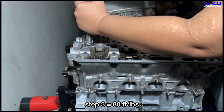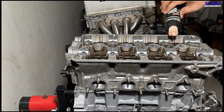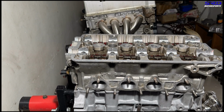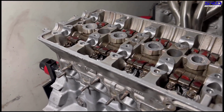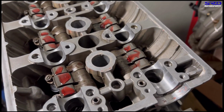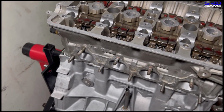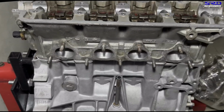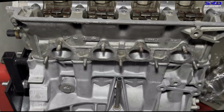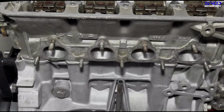All right. And now here, either assembly lube or oil, you have to lubricate the rocker arms before slapping on the cams. We've built a couple of H22s locally, and we do this, nothing happens and no problem. But then when the shop decided they can actually rebuild their own, they probably didn't do this. They rebuilt it and hey, it started eating rocker arms. We probably know why, right? You gotta be careful.